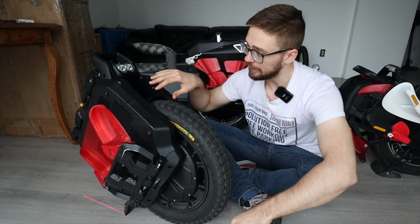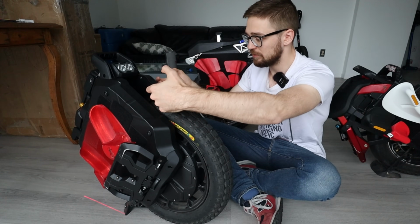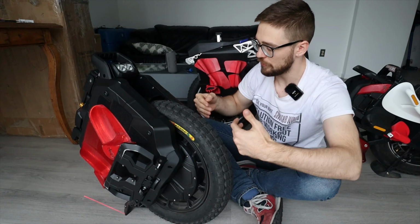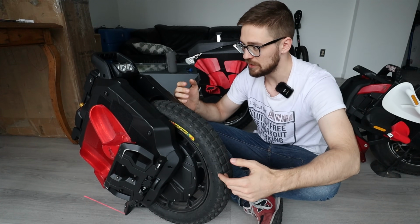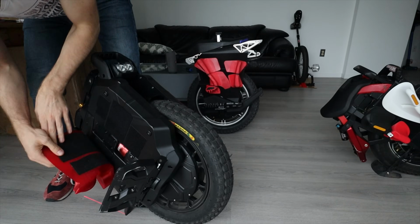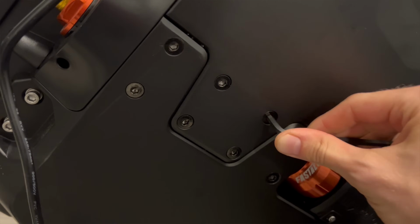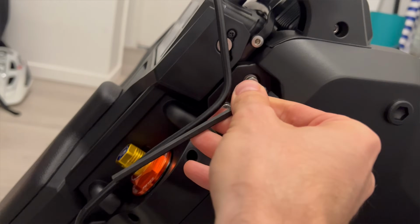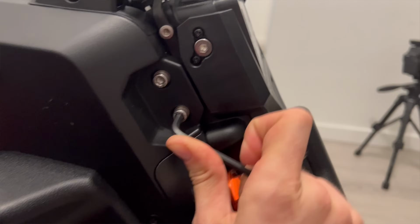And here we don't have that. In the middle, we have just a plastic mudguard. There's nothing that holds both pistons together. And essentially how those 2 pistons and 2 pieces of the side shell keep together is through, number 1, 8 screws that we have here on the side. And I was checking those after every ride. After my first 70-kilometer ride, every single one of those screws was a bit loose. I had to tighten them. And then those 4 screws on the top, I had to tighten as well after my first ride.